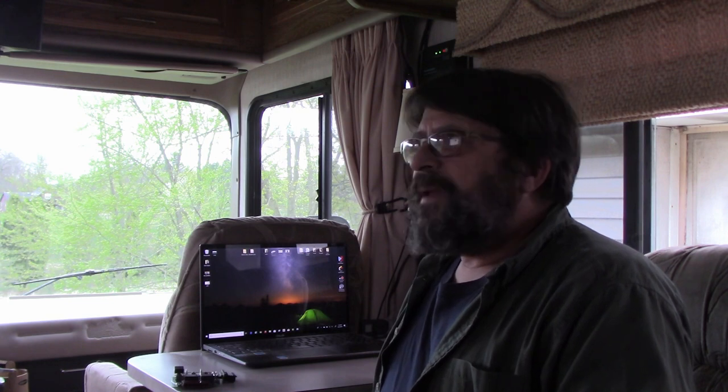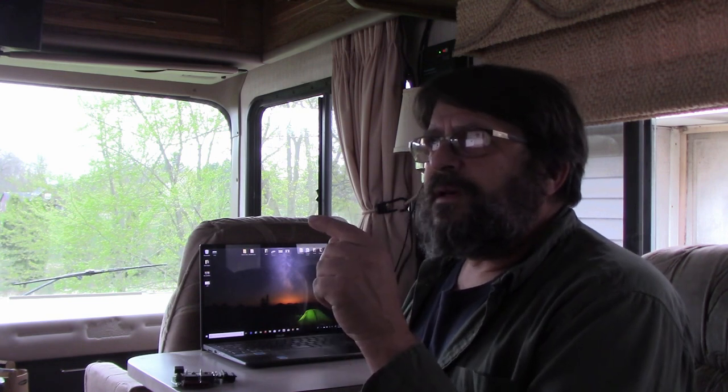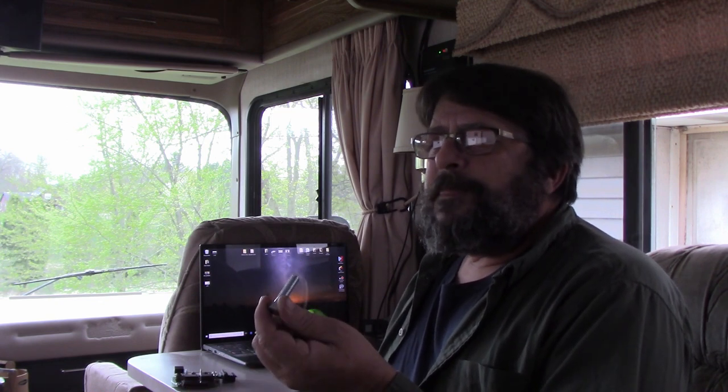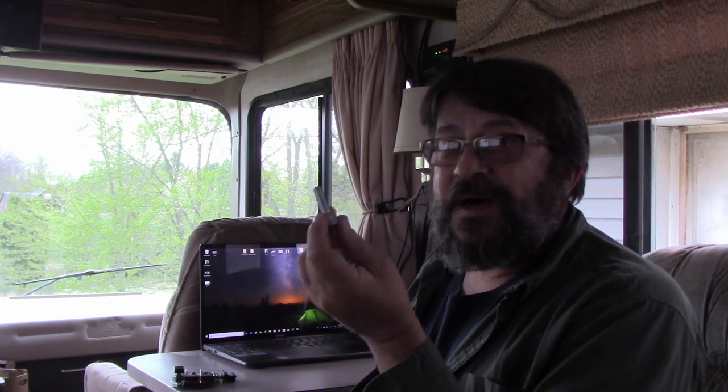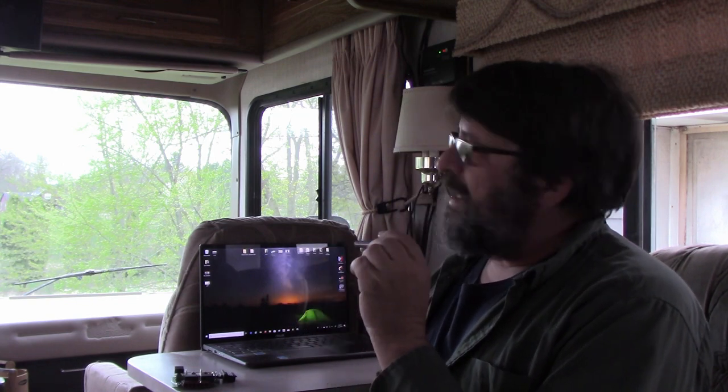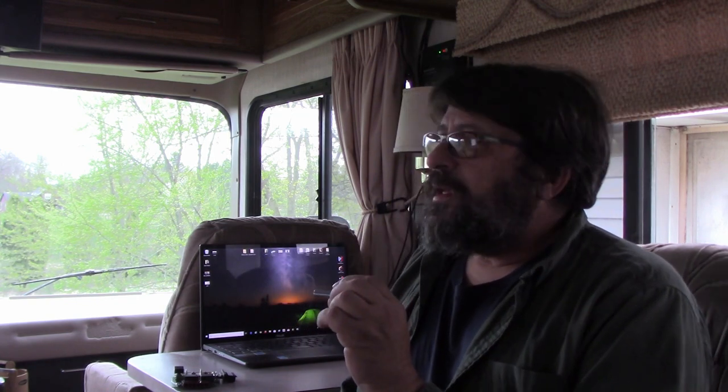But come down from the body of the motorhome. I'm like, I don't know, maybe Fleetwood put that bracket there for a reason. It used to have a bolt. So I found a bolt in the garage, and I put it in there, tightened it up, and it solved another major issue that since I've got the Bounder, it's always had this weird vibration at about 45 miles an hour.